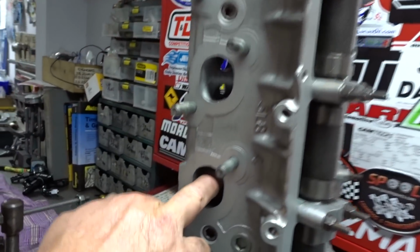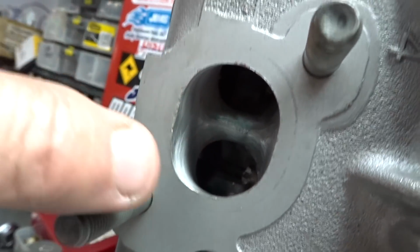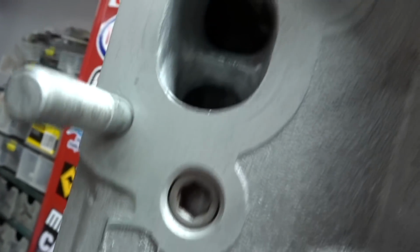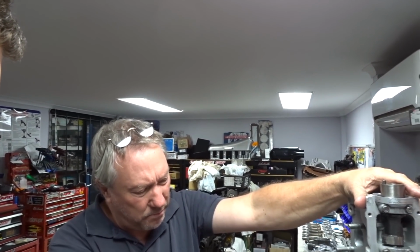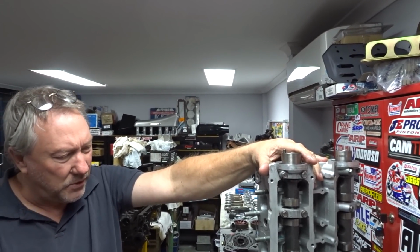And the exhaust, same deal. Just thin that bridge out in the centre and smooth it all through. Far out. So that'd take you ages because you do it all by hand, yeah? Yeah, do it by hand with a burr. So you burr it out and get your basic shape first with a single cut burr.